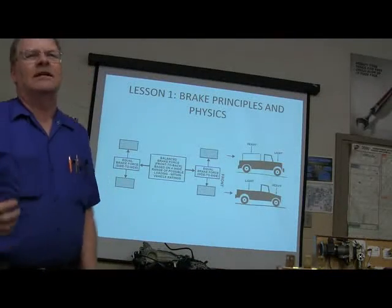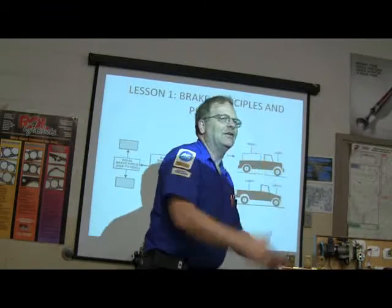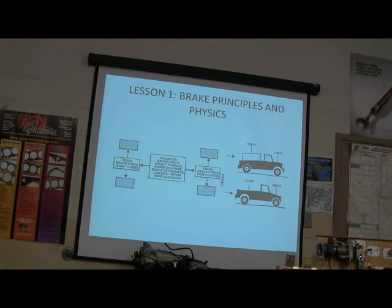So the long and the short of it is, we want to make sure that we don't let any brake pressure get to the back until the front has applied to a certain amount. It's the same thing with a motorcycle, because you can control the front brakes and the rear brakes. If you rely too much on those front brakes, you'll lift the back end up.